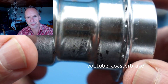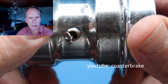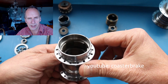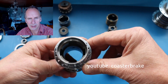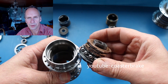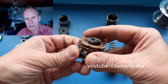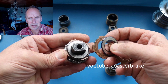This is a hub shell from the back hub. It shows no sign and no engraving but it is typical for Dürrkopp. Now let's look together at the left side into the hub shell — it shows that therein fits this typical disc brake, a multi-disc brake from Dürrkopp. These are the three discs that fit into the hub shell, and if we backpedal it presses the discs together so we can brake, and the bike stops.